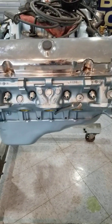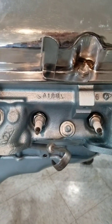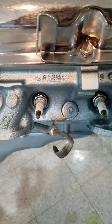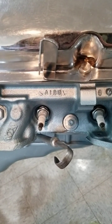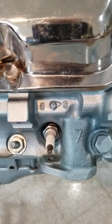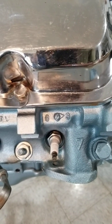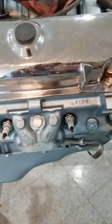I'm also going to show you: on the 670 head, the casting date is underneath the valve cover. But on the 68 cylinder heads, the casting date is right here on this ridge or flat area of the cylinder head. This one reads A, which is January, then 18 for the 18th day, and then 8 for the year — so January 18th, 1968. Like the block, this has the day and night shift marked on it. It's also got a 6 and 3 here, which I'm not certain about — maybe you guys can comment and let me know. Perhaps it was the time clock, maybe made at 6 in the morning or 3 in the afternoon.